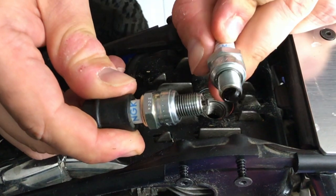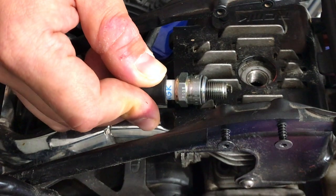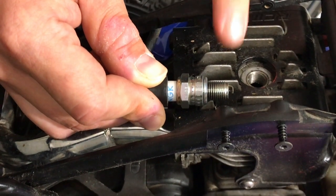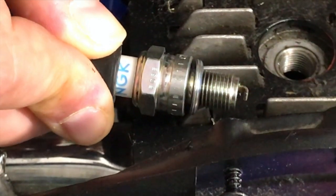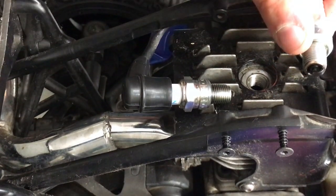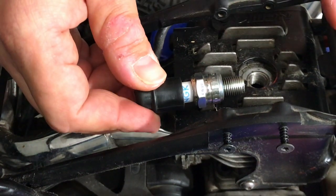Pulling the pull start as I did before, and you literally cannot observe any visible spark bridging the gap between the electrode and the plug — maybe very, very little, but it's almost nothing. So I'm gonna get a new plug — the CMR7H plug, which is a standard plug used on basically every 1:5 scale gas RC. I've already run this, I know it starts and runs. Take a look at the electrode on this new one — it is basically clean, while my old one is very, very dark, indicating I ran pretty rich. Doing the same test with the new plug: man, that spark — that's what you want to see! You can clearly see the difference. On the old one there was nothing; this is the best way to test your spark in the field.